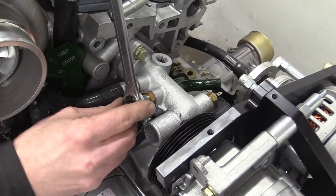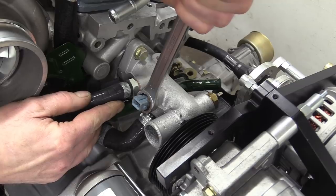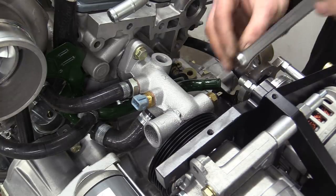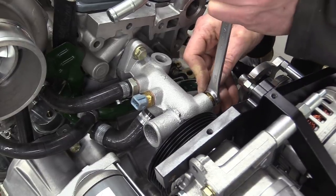It is pure coincidence that when perfectly tight, this sensor has the plug lined up horizontally, because the alternative means that someone would have had to add enough liquid PTFE around the tapered threads to make sure of it. The sensor for our analog temperature gauge gets the spanner treatment too.